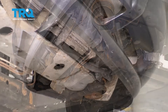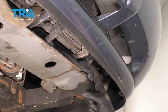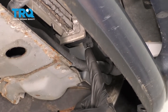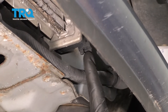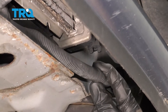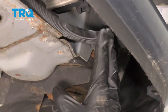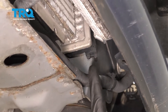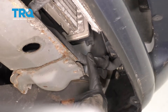Remove your shield. Now that we have that out of the way, we have a nice clear view of the bottom of the radiator. Over on the driver's side, you're going to find the petcock, which is considered the drain for the radiator. When I remove this, coolant's going to come out. I want to make sure I don't have anything underneath it that might divert that coolant and make a mess. We're going to try to divert this coolant directly into a receptacle so we can recycle it properly.